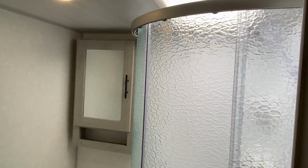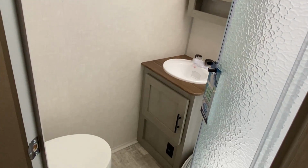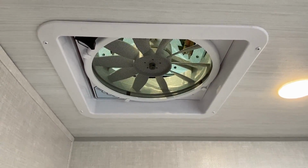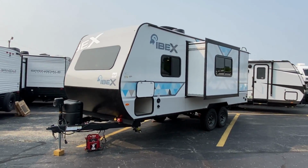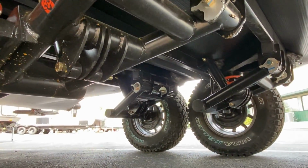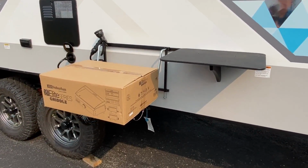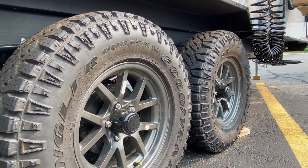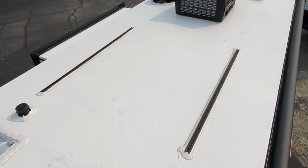People, you don't realize how vastly important a good suspension is to the long-term longevity of an RV. Imagine dragging this thing down the road without a good suspension. Every time you hit any sort of bump, it just rattle bangs all over the place. By virtue of the fact that it has that better trailing arm suspension, even if you don't plan on doing anything off pavement, off road, whatever, the RV will last longer because every single nut, bolt, widget, stress, like fastener isn't getting just rattled to death.